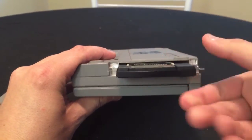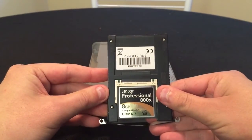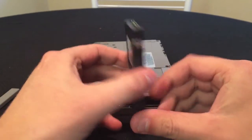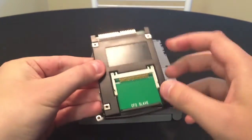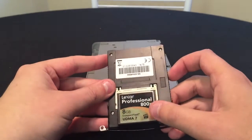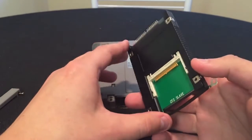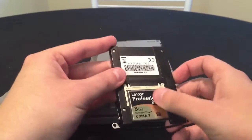There's a little flap here and then the hard drive pops out. Here's the compact flash that I am using with a little adapter. I think I bought this on Amazon and it actually has two slots for two different CF cards if you wanted to use it. However, on the Librettos, it will not recognize that secondary card for the slave — it only recognizes the master.